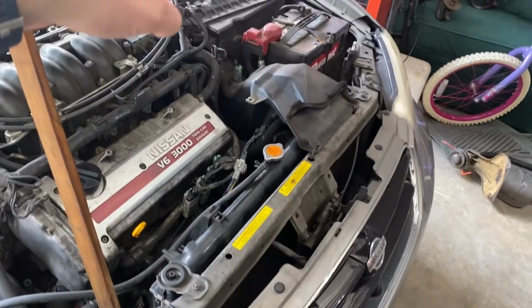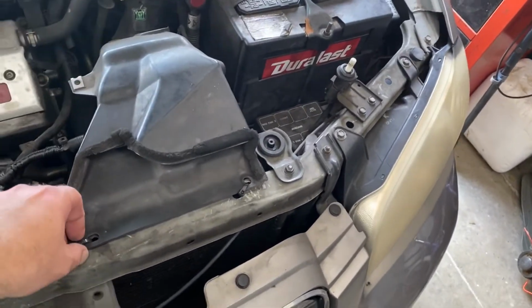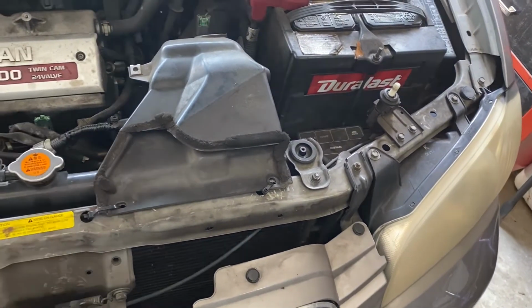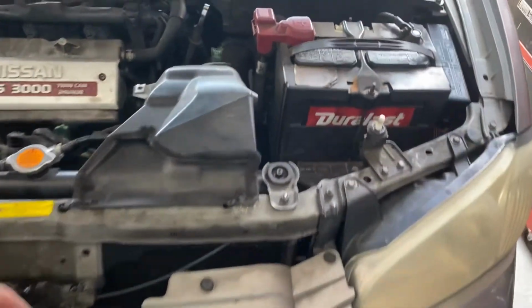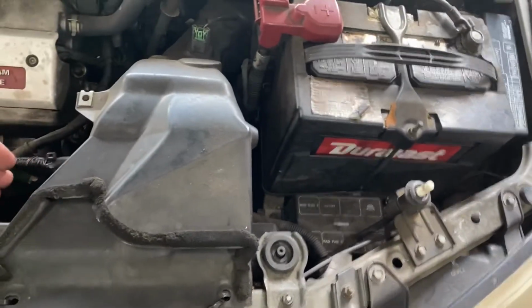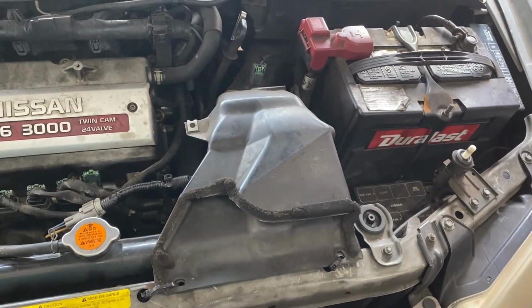First thing we're going to do is disconnect the negative terminal on the battery. I think there's 2 bolts. Then we have to take off this here, which is held on by some sort of pins, or in my case zip ties. And you need to remove this airflow sensor to get to it, so you can remove the upper hose. Some coolant will leak, so get something down underneath to catch it. Make sure you don't have any pets around, and then we're just going to swap in the new one.